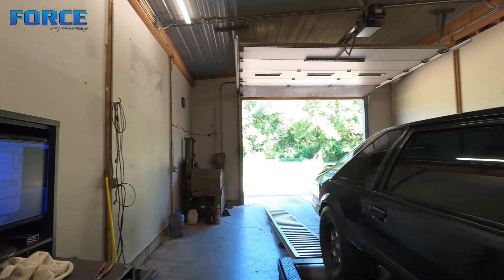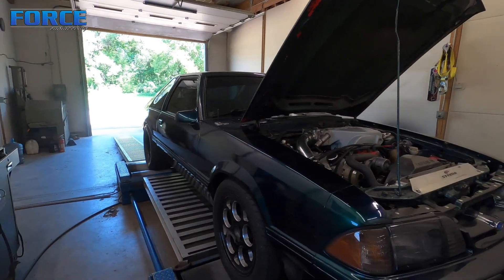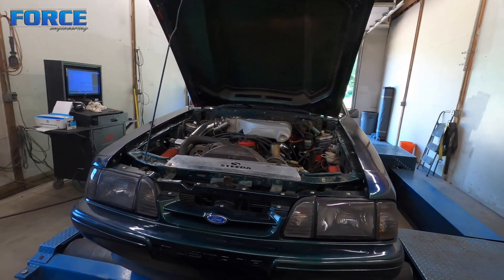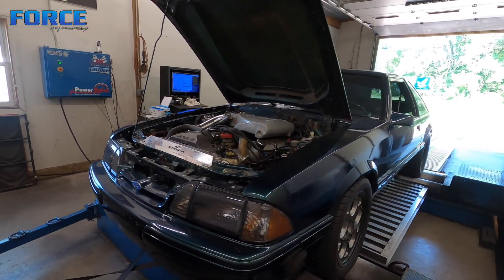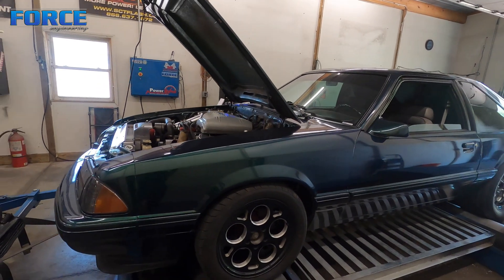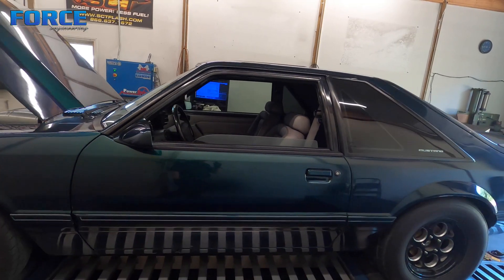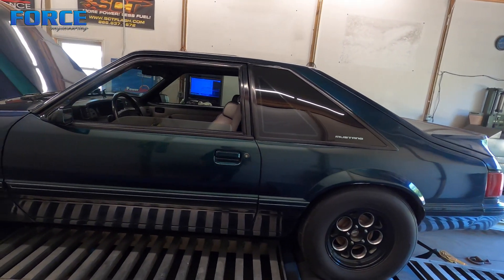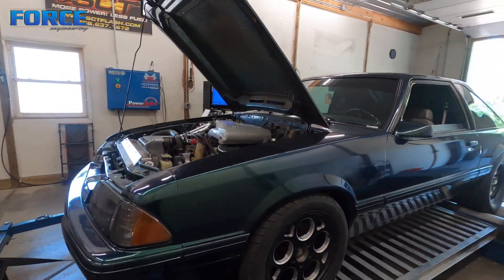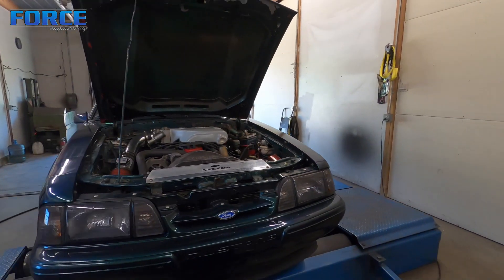As I said in the beginning, strokers typically don't make a big power number with this top end kit. If you put a 347 with like a 200 or 210cc cylinder head and had a more typical intake runner setup, you'd see more. Also, I don't know exactly what cam is in this — a lot of guys tend to undersize the cam. I'll see strokers come in with like an F-cam, which works well with 302 cubes, but with a 347 it's just not big enough to work well in the RPM range. It's all about the combination.